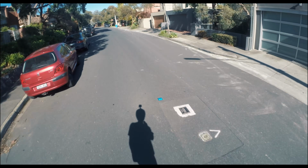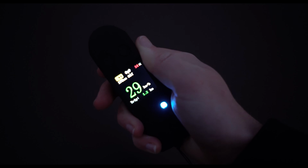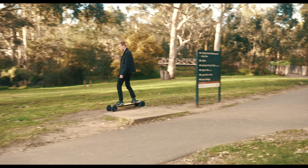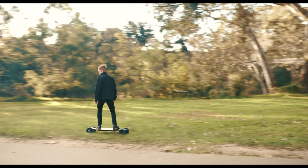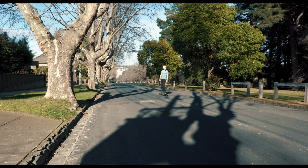This means that in reality you're only getting something in the range of like 40% of the battery usable if you're riding fast. While it technically has a 35 km range on the street setup, you're going to notice that below 75% battery, you're not going to be able to go up hills at the same speed, and below 60% you're not going to be able to hit full speeds on flat. This is further reduced if you use the AT setup.